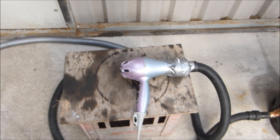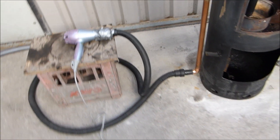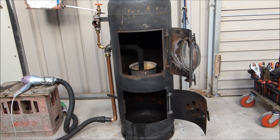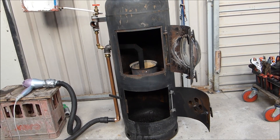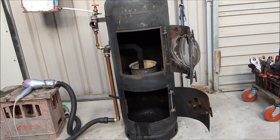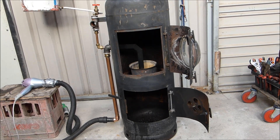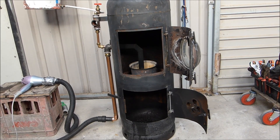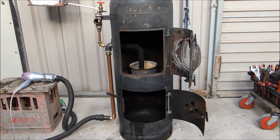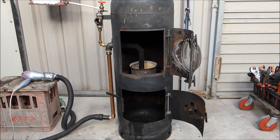However, that hair dryer will work. Now the thing about hair dryers is they're not continuously rated motors — they're designed to come on for a while and then your hair is dry and you switch it off. It's not designed to come on Monday and switch off the following Sunday, so it ain't going to work long-term. But if you just want to prototype and test something out, yeah it's going to work.